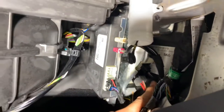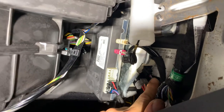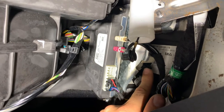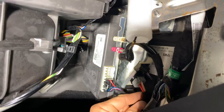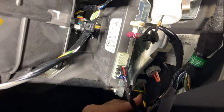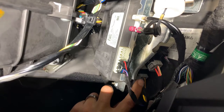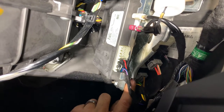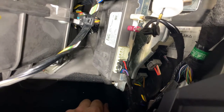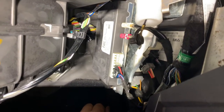By the way, the TPE is not going to do any good over there — I just looked for completeness. What this module is basically doing is converting your input wires. This little plug here is left turn, right turn, and brake lights — they feed into the TPE and it converts them so that left turn, right turn, and brakes get unified onto common circuits. This is more than likely your power input on the red wire, your ground here. Then these are the output wires — green, yellow, and brown. Yellow is left turn/brake, green is right turn/brake, and brown is taillights — those go all the way back to the four-way plug at the rear bumper. Notice there are no other wires coming out of that output socket, which is a red flag that it may have no other provisions beyond those three circuits.